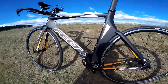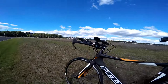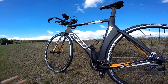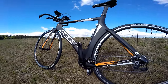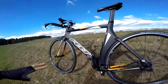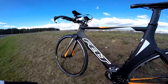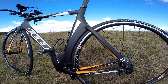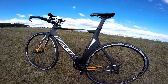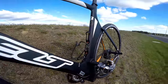The frame is super stable on the road. Even today it's really windy and this one is stable. That said, you don't want to force this bike to turn — it doesn't like corners, and I disagree with reviewers who say it's good at cornering. It's not, but it's not supposed to be, because we put so much weight on the front wheel on a TT bike, so it would behave really crazily on downhills in windy conditions with deep-section wheels. This geometry is really cool. By the way, I'm 182 centimeters or six feet tall and size 56 suits me perfectly.